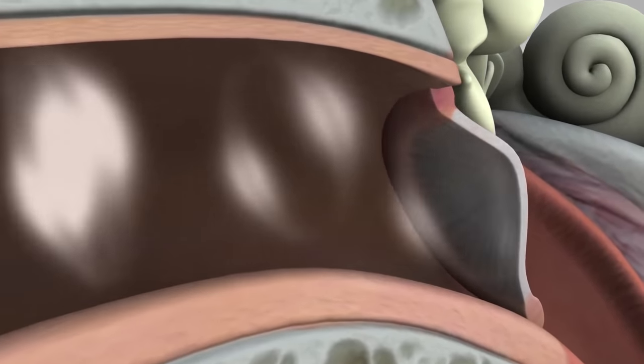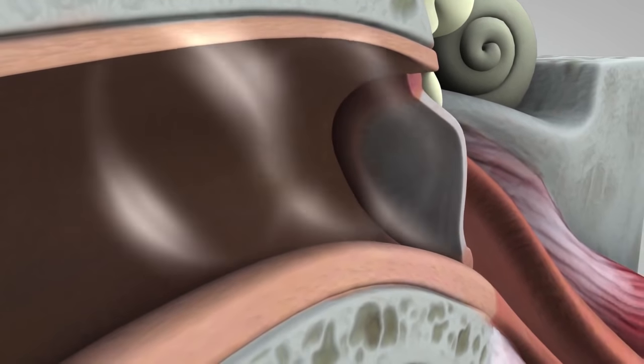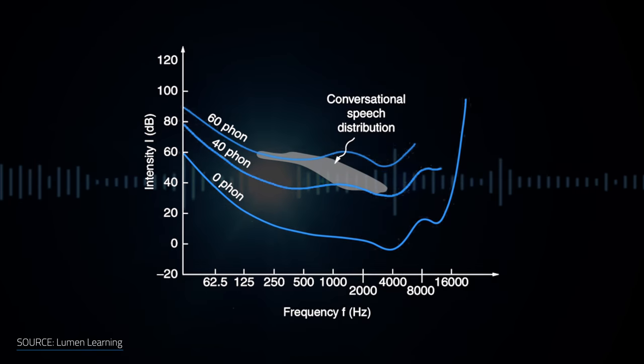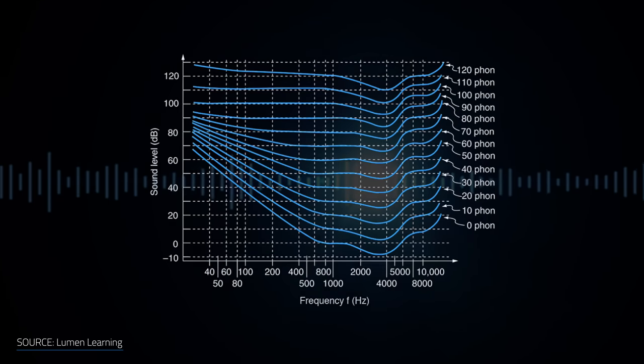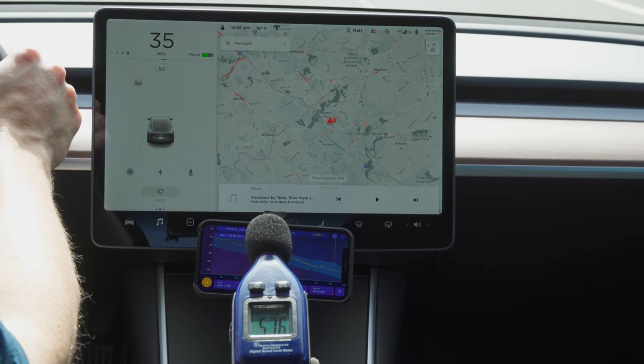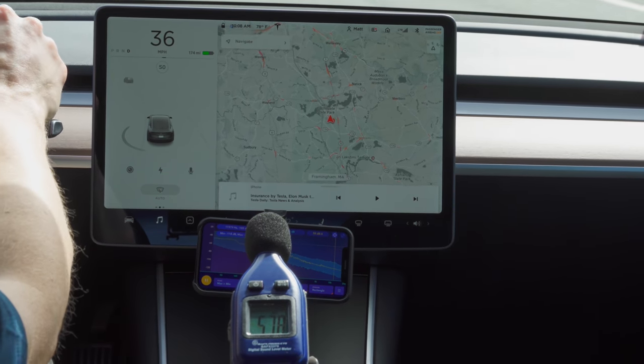There's a good reason for that based on how we perceive sound. The loudness of a sound will feel like it's doubled every 10 dB, and the human ear is capable of detecting a loudness change every 3 to 5 dB. So why would my car feel like a noticeable change if there's only around 3 dB improvement overall? I think that comes down to how the human ear perceives loudness over a range of frequencies. The ear is geared towards frequencies in the range of 2000 to 5000 Hz, which means sounds in that frequency range sound louder than sounds at other frequencies, even at the same intensity or decibel level. Our ears don't hear the loudness of each frequency equally across the spectrum. This is why taking a reading with an unweighted decibel meter can be perceived in a very different way. The tone or quality of the sound in the cabin has absolutely changed after I installed the door seals. My best guess is that some of the frequencies I perceive as loud have been filtered out now, which gives the impression of a more comfortable and quieter cabin.